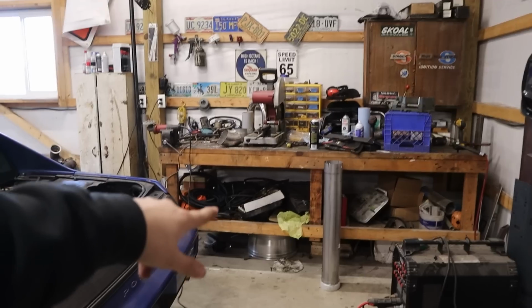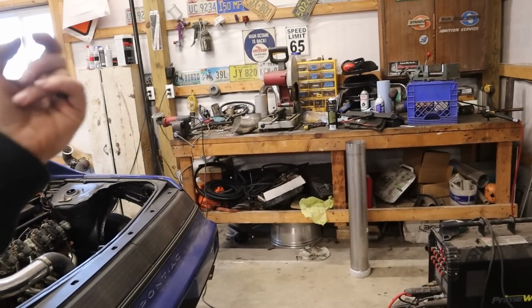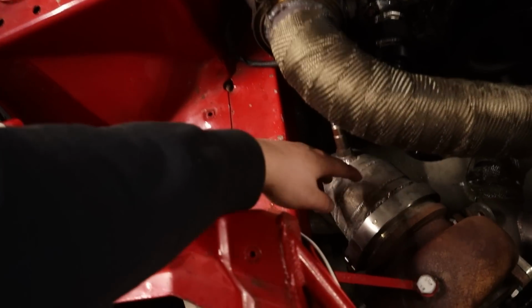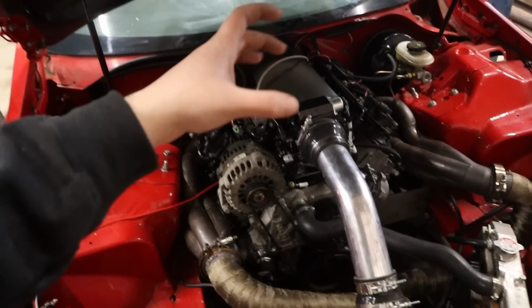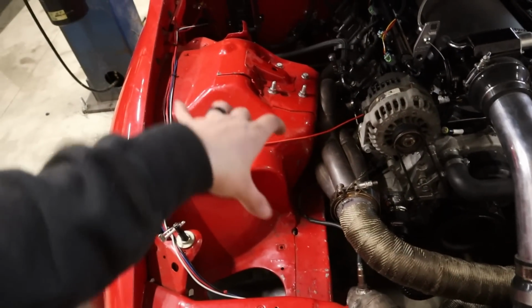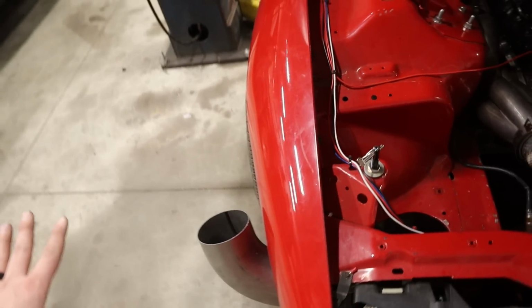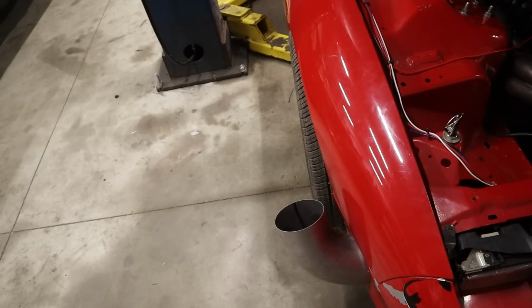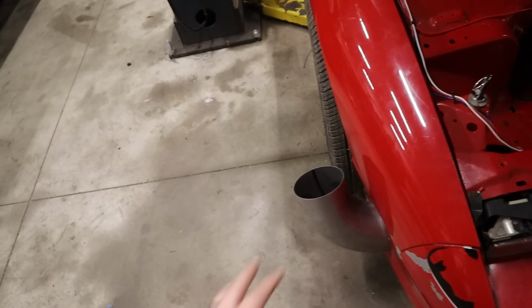Again, I can't remember if I mentioned it because I've just been nose to the grindstone. 5-inch pipe is too big for my chop saw, so pie cuts were out of the question, and I didn't have any tight radius bends. So I reused the aluminum section here because it had kind of what I needed, where it was pie cuts going down and then kind of curved this way a little bit. Modified it a skosh, and then was able to make the rest work. But 5-inch pipe is so annoying to work with. I wish I had tried harder to talk him into going to 4, and then we could have stepped it up to a 5-inch elbow out the bumper.